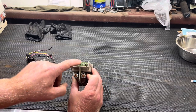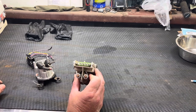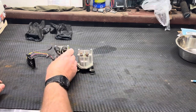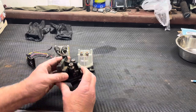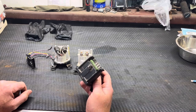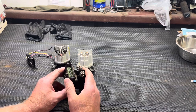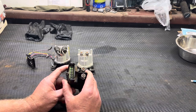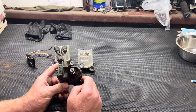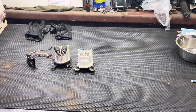It's the gray one with four leads. GM used these from 85 until they went to the electronic DS injection pumps — DS4s — around 95. Then you got the black one with three wires. Don't use a black three-wire unless you have the computer-controlled injection pump, because the pump-mounted driver controls how long the glow is. The black controller is for electronic pumps; the gray ones are for non-electronic pumps.